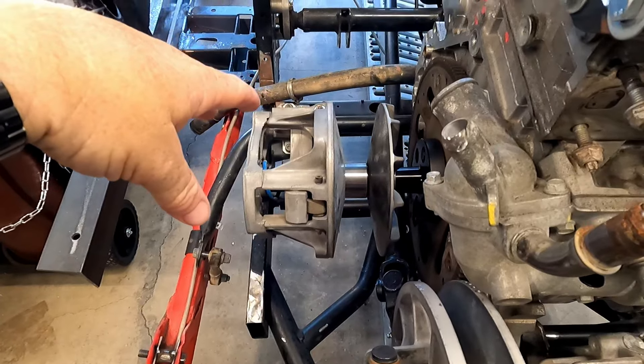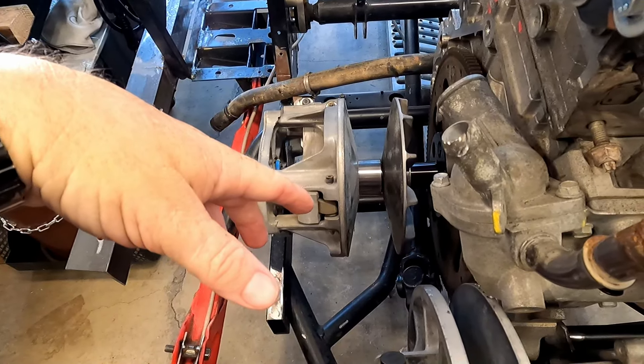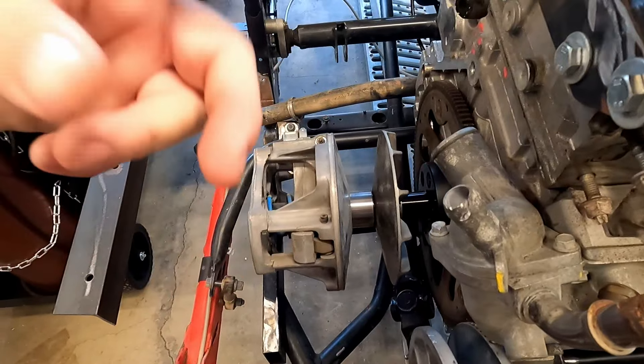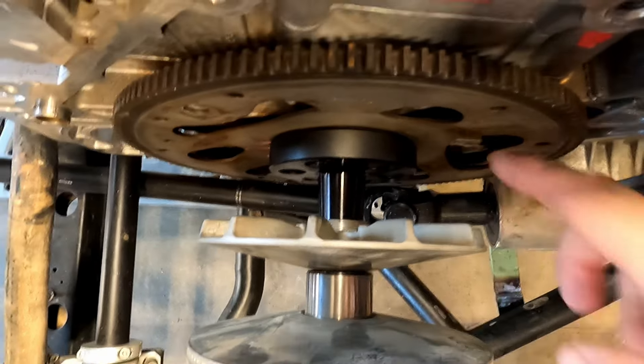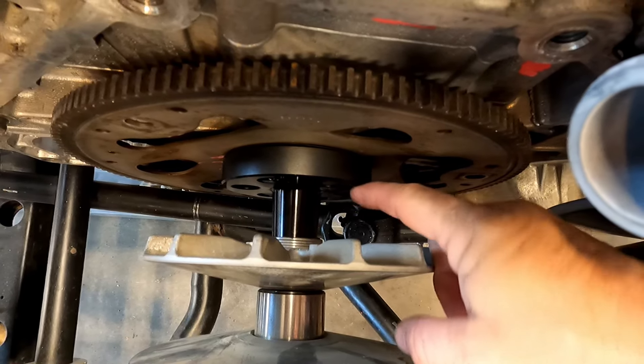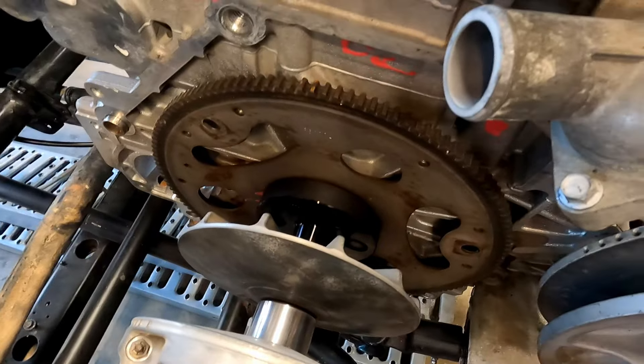Here's another look at a different angle. I could push the engine over that much, but then we start running into issues with the shock and the frame and I really don't want to do that. If I push it over, you can see how much room I have. The 33-millimeter clutch will go nearly all the way to the back, and that puts it almost perfectly in line with the driven clutch. I'll take a little time to save up and get that clutch.